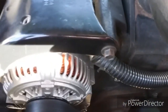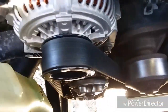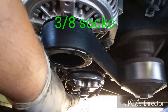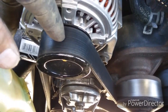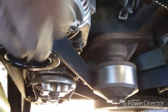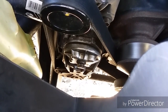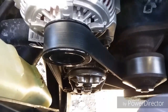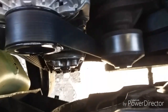I fixed it — it's all good now. Pretty easy, took about 15 minutes. All you have to do is get a 3/8 socket wrench, stick it in there, and move the tensioner toward the driver's side of the car. Then you slip the belt off the alternator pulley. After that, you unbolt the pulley — it's a 13 millimeter — and there's a back bolt that's a T50 hex. Take that off, buy the new pulley, put it on. I greased it a little bit, then repeat the process and tighten the 13 mil back on.